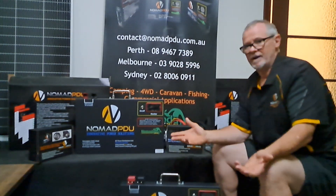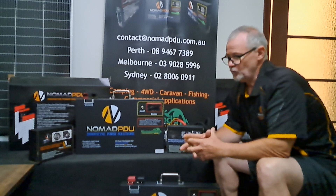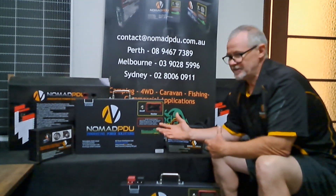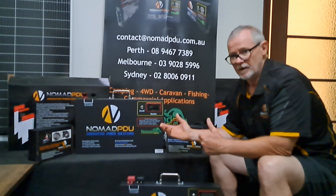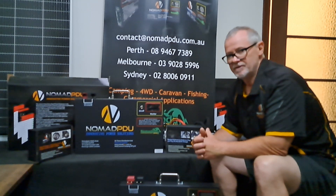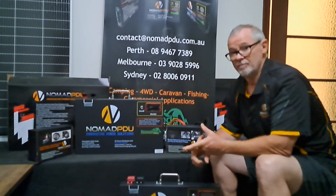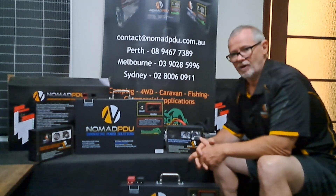You must have a VSR between the crank battery and the auxiliary battery, otherwise you'll drain your crank battery. If you direct-connect from the crank battery to the auxiliary, it's going to drain it. You also want to charge your auxiliary batteries with a DC unit to stabilize the voltage and amperage, which gives the battery a longer life. The rule of thumb is put a DC in there just to be safe, and DC units now can support multi-chemistry charging — AGM, lead acid, gel, and LiFePO4 lithium.